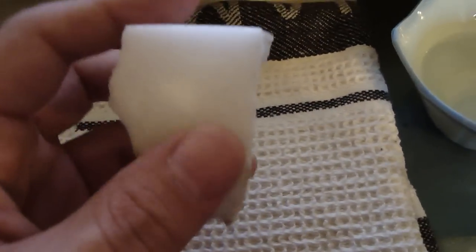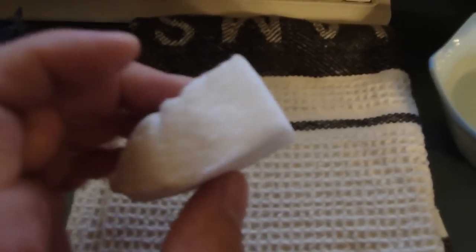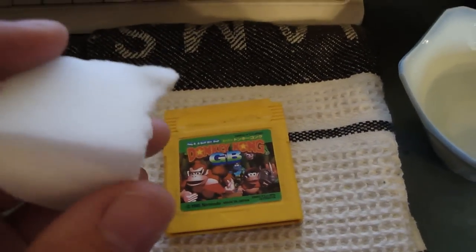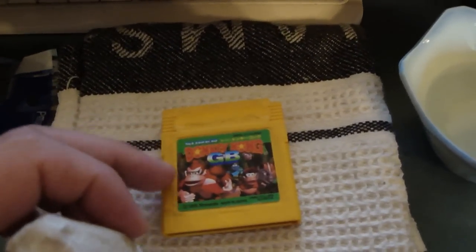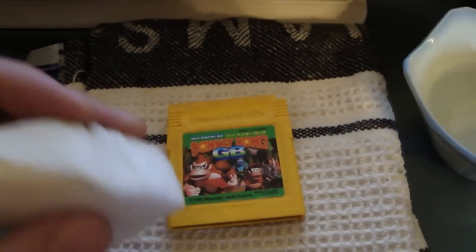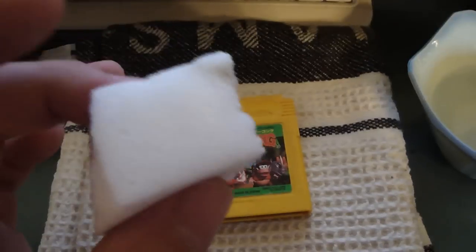You can use this dry or wet, but I don't really recommend using it dry because instead of acting like a sponge and cleaner, it acts more like sandpaper and will really file down plastic. If you have any texture on plastic, it'll rub it completely off. This is a pretty strong little sponge, but I believe the active ingredient inside is bleach.